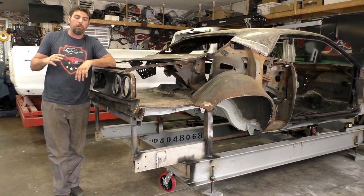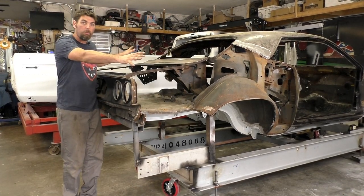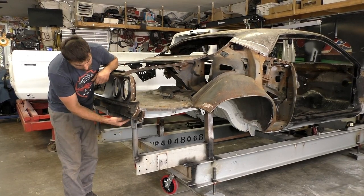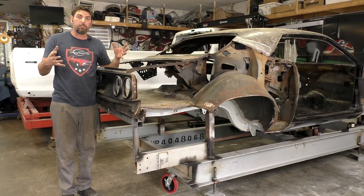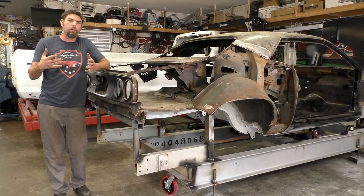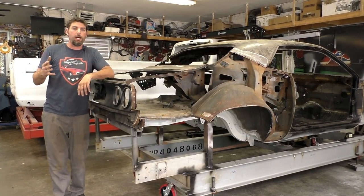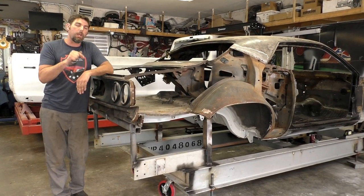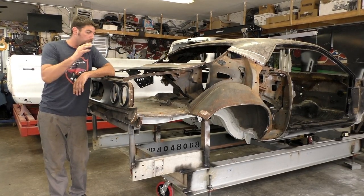I really hope this video helped you in wrapping up on frame jigs in general. If you're going to do major structural repairs - for instance, we're going to cut the whole back of this car off minus the two frame rails - we want to know when we're putting the new parts on and as we're sandblasting, these frame rails aren't going to move and this back panel isn't going to lift up and down. That's the whole point of the frame jig: when we start cutting stuff apart, the frame jig itself takes the structure. You could take something as simple as some I-beams or square tubing, build a structure that's not going to bend or twist, that's going to support your car and make it mobile. Try to put levelers on it and get that car onto a flat chassis table.